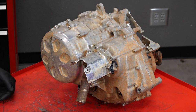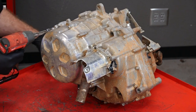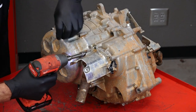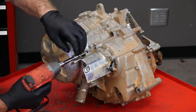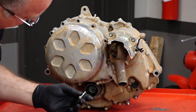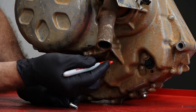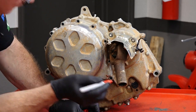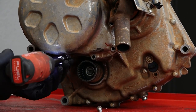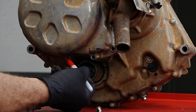Let's dive in and see what kind of shape the clutch is actually in — this is going to be interesting. Now all the bolts are going to be the same length and head size, which is 8mm. Take note: this particular location actually has a copper washer on the bolt. We'll mark any of those so we don't miss them when putting it back together. There are three locations with copper washers.